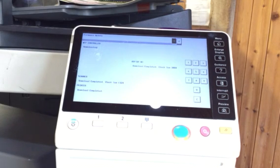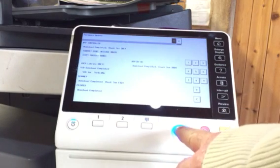It's important when you transfer the firmware from your PC to your memory stick, in the correct format of course, that you don't use too big a memory stick. We use about a 2 gig memory stick. Okay, that seems to be okay. It's gone to blue here. Press start.